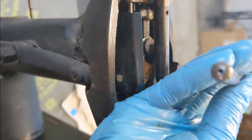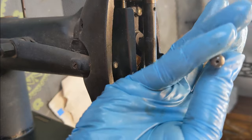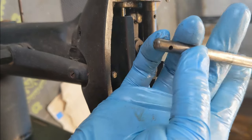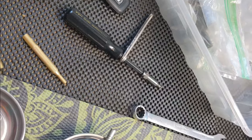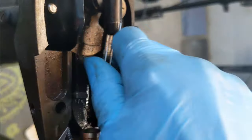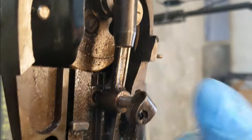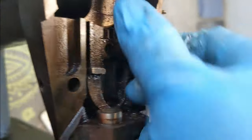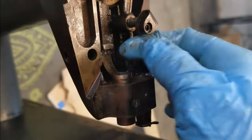Down here at the bottom you can see — hopefully you can see — it looks like a round hole where the needle goes in. So a little bit different. I'm going to put everything that has to do with the needle bar, that I have not already put in separate baggies, into my little kit. Hopefully I can pull out the needle bar clamp — usually they just stick in there. Spray a little more penetrating oil there. I should be able to also lift out this piece unless it's screwed in.